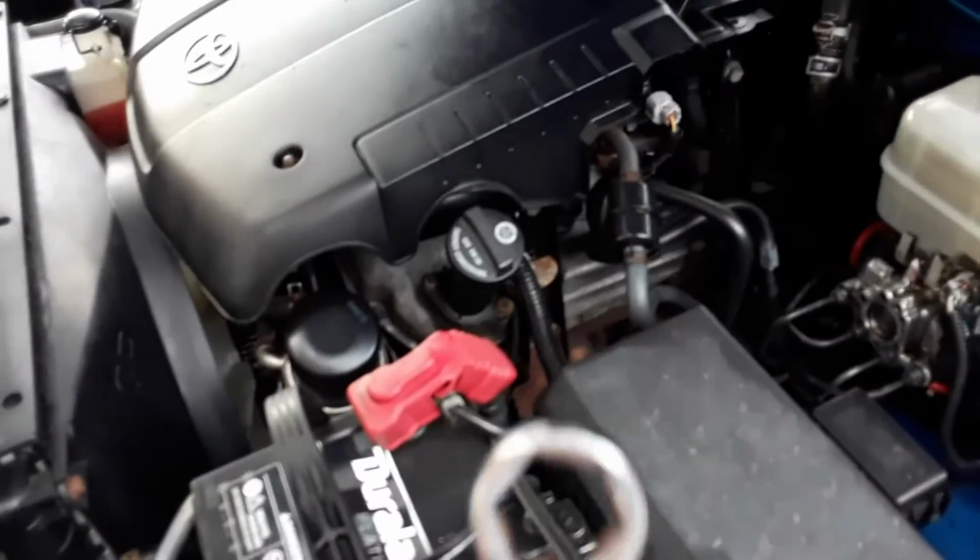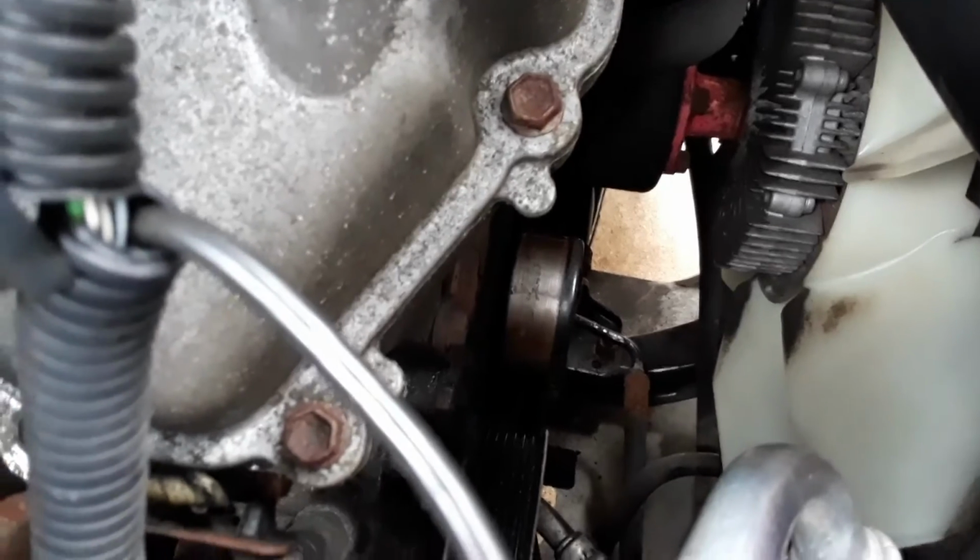Okay guys, it's all bolted back on. And I highly recommend, nice and quiet now and spins free. I highly recommend that when you take yours off, if you have a 6-point wrench or socket, to use that, because mine was on really tight, and I really think that it would have rounded out if I would have tried using a 12-point.